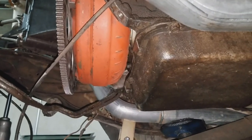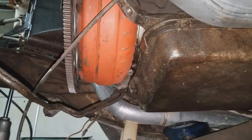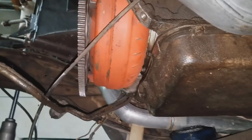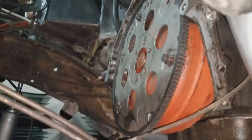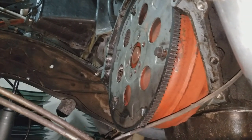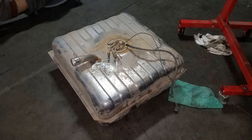What we're doing is pulling my torque converter off. There's a guy here in town who will cut the front of my torque converter off, machine it, and weld on the front of a torque converter from an '84 that will fit onto my big block flex plate.